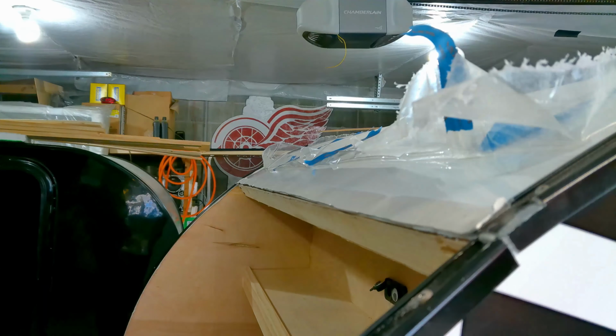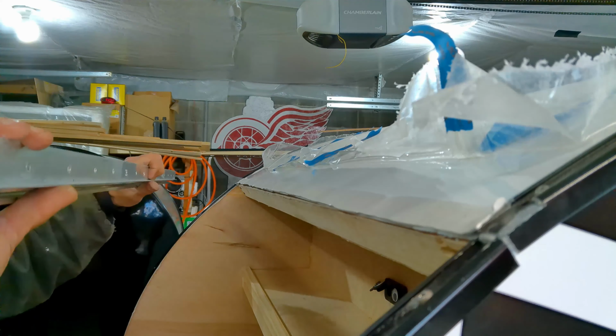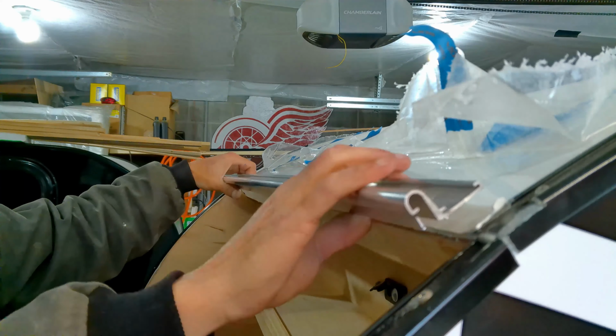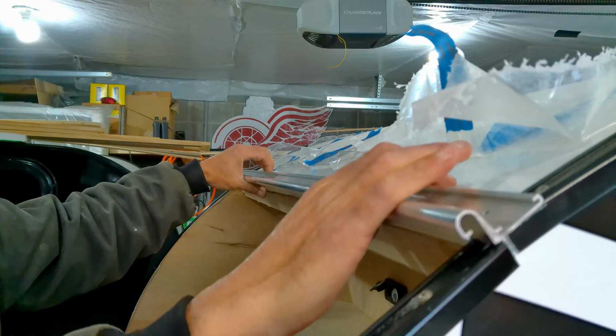You're just filling a small gap, and it's nice and beautiful all the way across. So I got to pre-drill these holes. I'm going to put some butyl tape on there first so I can drop the spacer in place, and then I'll put the hinge right on top of that, and we'll secure the hinge. First row of butyl tape. Now I'm going to take the hinge and the piece I pre-drilled on the bottom and set it up there, but I'll pull the hinge away.